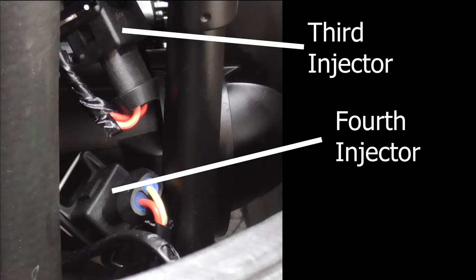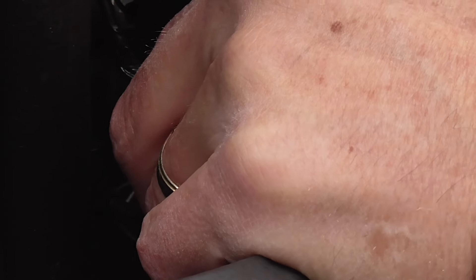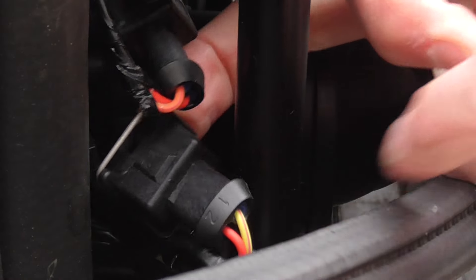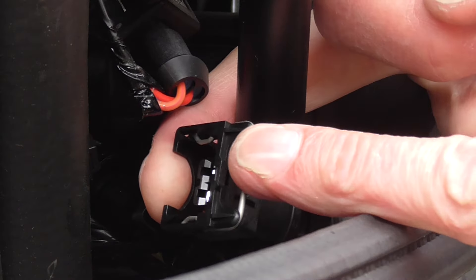The one thing you're going to notice is that when you get to the fourth injector, it's different — the fourth injector is actually turned upside down compared to the other three. What I did was remove the electrical connector for the fourth injector. This is the fuel injector electrical supply for the very bottom cylinder. I'm going to push that down, and when I do, I'm going to lift the fuel injector out at the same time. Those pop out pretty easy once you release that spring — you can see the spring up close, and you just push those in to pull it off.